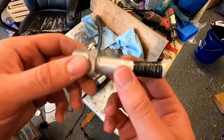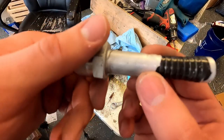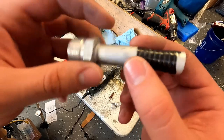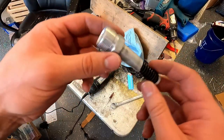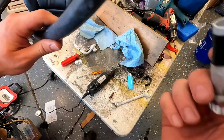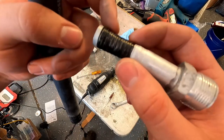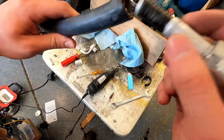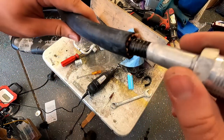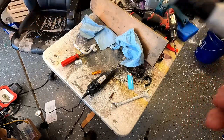This is kind of what it looks like once you cut the ferrule off. Hopefully I should just buy a new ferrule, slip it onto this area, slide a new hose on, crimp it on, and have a fresh fitting. It's interesting because I didn't realize these were tapered. Starts out larger and then goes smaller, larger again. So it fits on pretty snug, but once you get it in, it feels loose, but it should be fine.